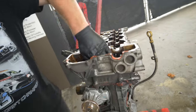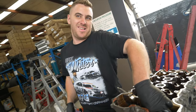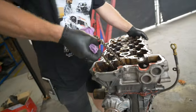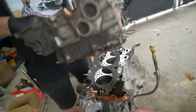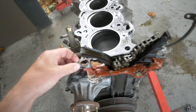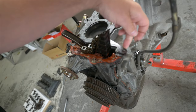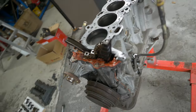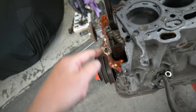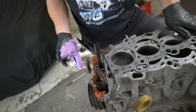We've got another head, that one can go on our spares. Look at the new gasket — it's a stock one. Has that been cut? It's actually missing the front part. So that's why it had all the goo in it. That means they've flipped this upside down, pulled the oil pump off, the factory oil pump has broken the head gasket. They haven't pulled the head off — they've just banged a new one on and gooed it up.